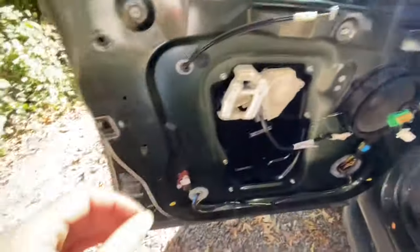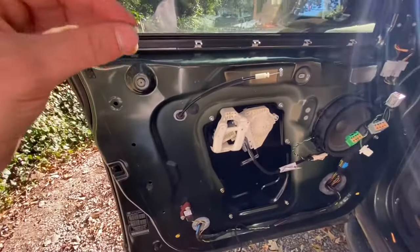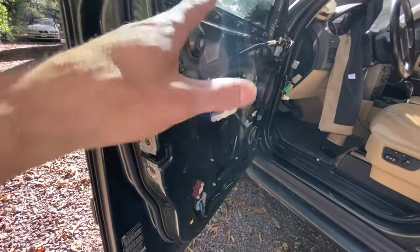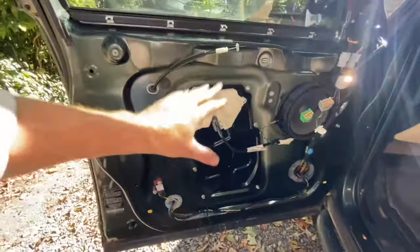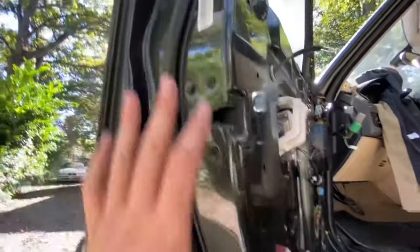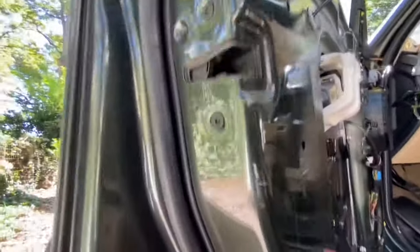So, a lot of videos and things — there's this one guy who shows what the fix is. The actuator in here has a little white tab that is broken, and above that there is a kinked little metal retainer piece. In that video, what he tells you to do is bend it down to prevent the white plastic piece from overextending or underextending — whatever the actuation issue is. But that requires removing the window and the window motor and all this other stuff, and I am too lazy to do any of that. So I figured there has to be a quick and easy way. What I did — pay attention — remove the two or three screws here, and I let this piece that he shows in the video kind of freewheel. I want to remove the screws here and zoom in to show what I did to make it work.